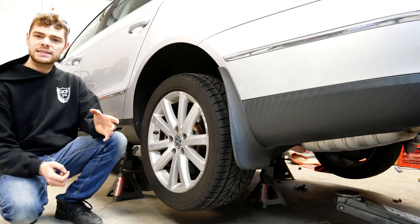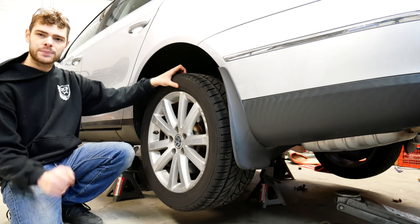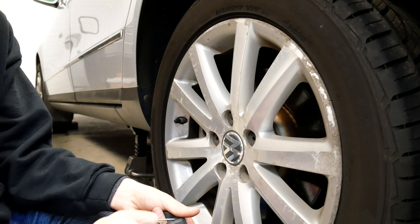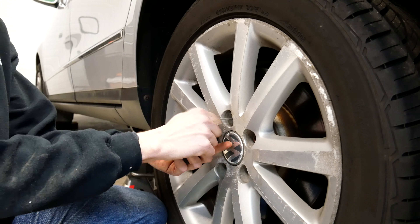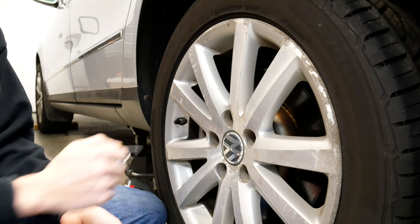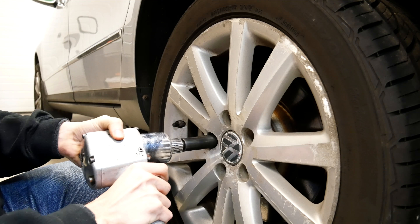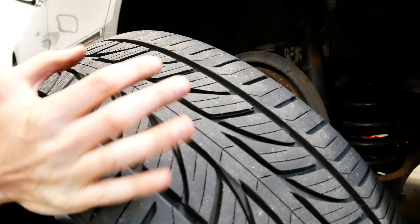Once you're sure that your car is safely up on stands you need to go ahead and get this wheel and tire off. If your car has these lug nut caps, which a lot of Volkswagens do, you need to go ahead and pull them out. They do come with a factory puller but that's pretty easy to lose. Then you have access to the lug bolts and you could just take those out. With that done we could go ahead and remove the wheel and tire.